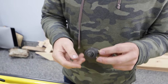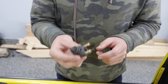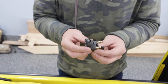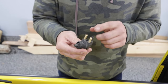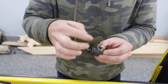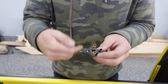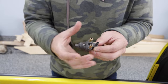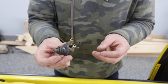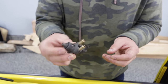Since we just touched on fuel lines, let's cover the fuel selector. This fuel selector is up front and it's very cheap — it's on OSD Marine for around $25 to $40. There are so many problems that can be caused in your ski by this fuel selector going bad. Number one, it can go bad from the green goo we just talked about, but it can also go bad over time because there are seals inside that seal off for on, reserve, and off. If it's an original 90s ski, that seal can have a leak and draw air in from the top, causing all kinds of problems that are very hard to track down. Replace it — it takes five minutes and we'll link it below.